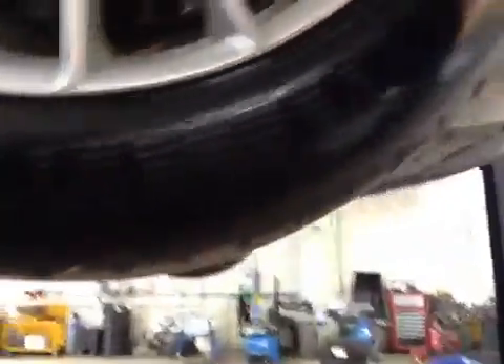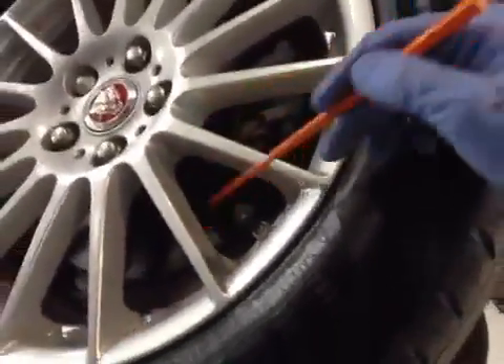Just the passenger side — passenger rear tyre. Tyre tread, again below 5mm worth of tread depth. The tyre is in amber. The rear brakes are in OK condition. The rear brake pads are falling on about 4mm. The pads are in amber, disc is in green. The tyres are in amber on the health check.